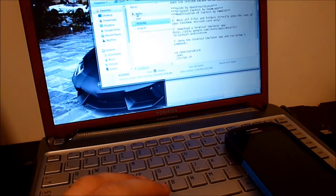You can go ahead and take these three files — the GS4EX, the PWN, and the script.sh file. You're going to want to cut them and put them on your SD card. Two important things about your SD card: you want to make sure that it is formatted to EXFAT. And you're going to want to make sure that you drop these files on the root of the SD card — basically don't put them in any folders.